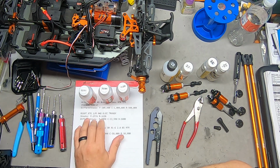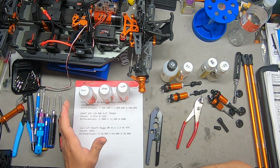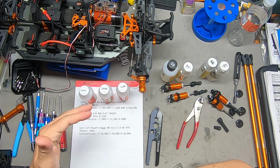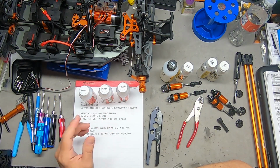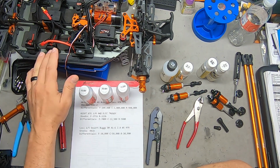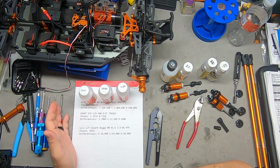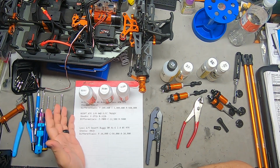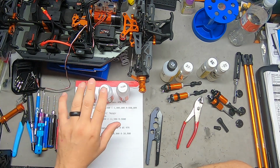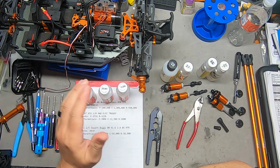It's locked down a little tighter than the 8th scale, and the 8th scale and this 7th scale are still really close to each other. This definitely has bigger wheels and tires, but the overall dimensions as far as wheelbase and wheel track are not that different. It's got a much bigger motor, and it's running higher cell number than an 8th scale race vehicle would be, but I want this thing to be able to turn well. At the same time, I do want it to be able to hold a straight line reasonably well. That's why I'm going, you know, with the 30,000 in the center. I want the power to go to both ends well without it, you know, going much more to one or much more to the other.